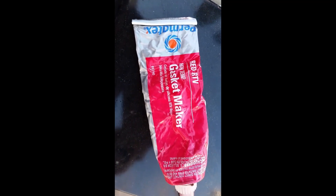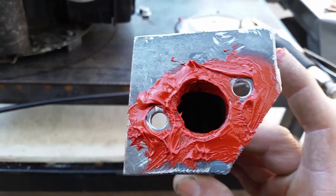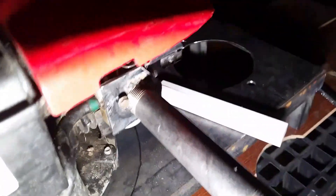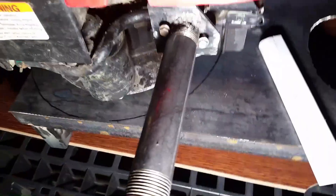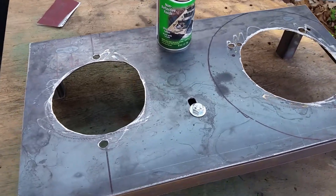Now we've got the intake ready. I'm using this red RTV gasket maker — works really good. I want to make sure I get plenty of this on here to seal it nice and tight up against the carburetor of this lawnmower, where it'll hook up to the gasifier to pump the wood gas directly into it. Now you can see all that hooked up and get the idea of how this is going to operate. Back to the rattle can to get this to match the rest of the build.